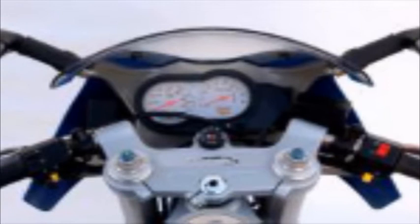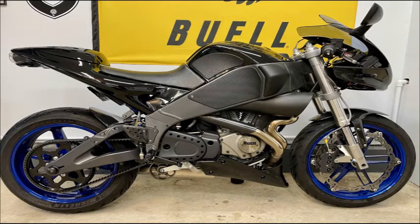Of course, if there's no gas tank, one is left to wonder what resides underneath the faux gas tank — why, that'd be the airbox, of course. As the air gets crammed through the ram air intake, it then gets shot up and over through a venturi into an 11-liter airbox. The airbox was designed to be of a zero-resistance type so that air will have an easy time flowing through its cavity. After the box, air flows through a 45-millimeter throttle body and gets hooked up with a shot of fuel from an injector, one per cylinder.